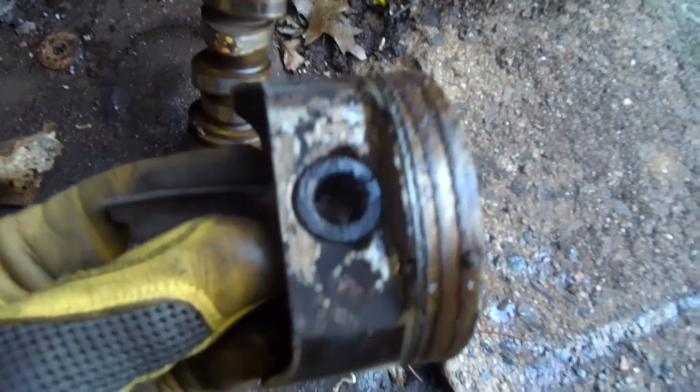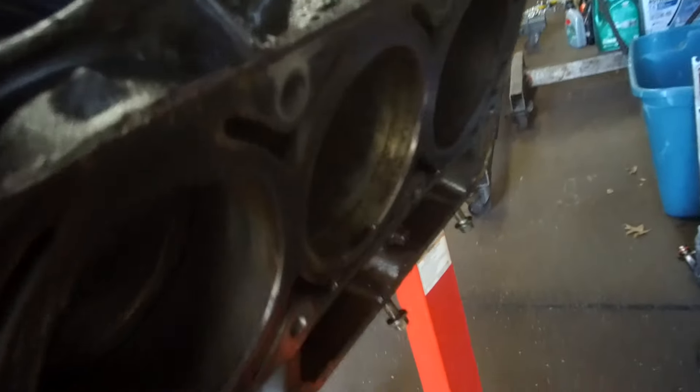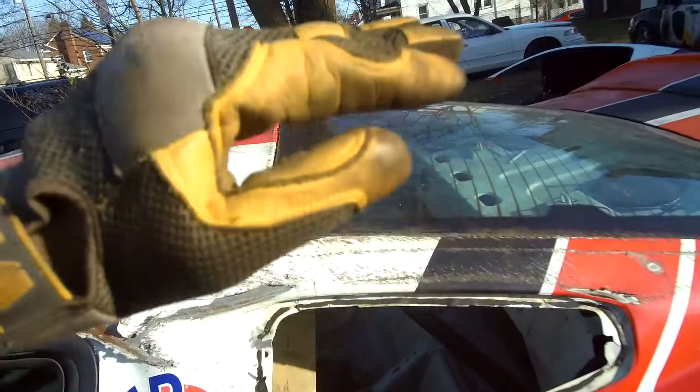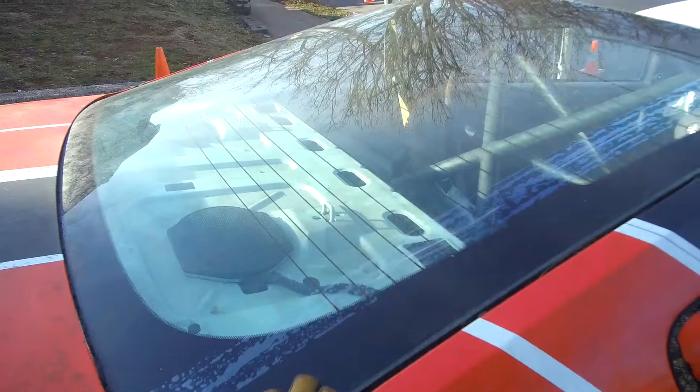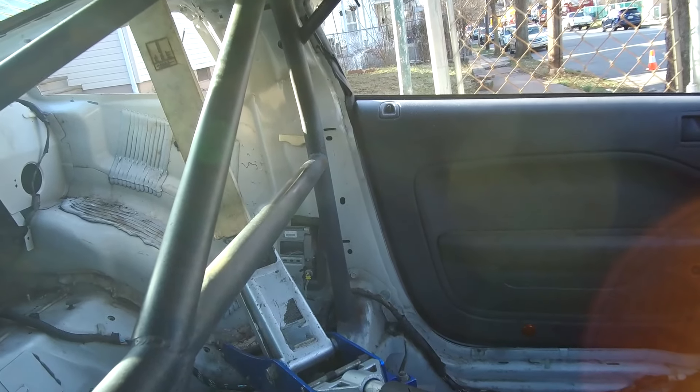You can see it widened up real big. The problem I'm having is on the other side — the window is folded into this crease right here. In theory I need to bend this up so it folds out, and that side should close down a little bit so I can continue to cut and hopefully lift the glass out. I'm jacking it up and the window on the other side is starting to close.